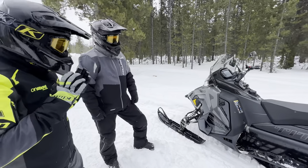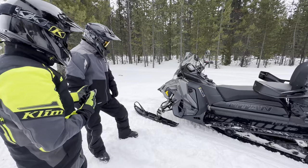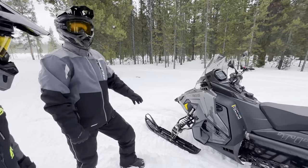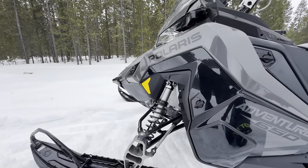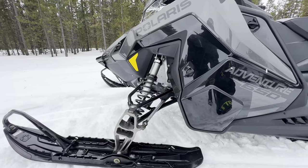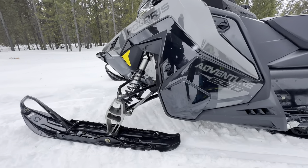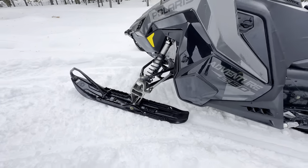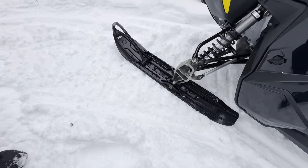There's a lot different with this sled this year, starting with the front end. We changed the geometry to try to get rid of a bunch of steering effort, but still be playful on the trail. It's a taller spindle for more ground clearance, and the front A-arms have an arch now for higher clearance. The ski is specifically designed for this IFS, so we can keep it playful and fun and still good off trail.